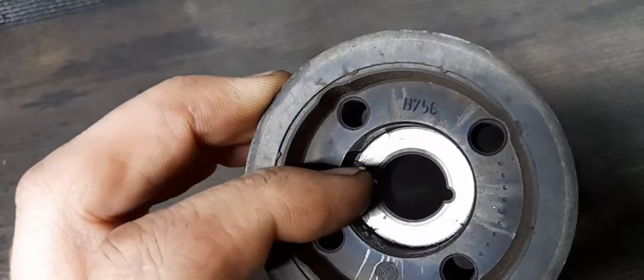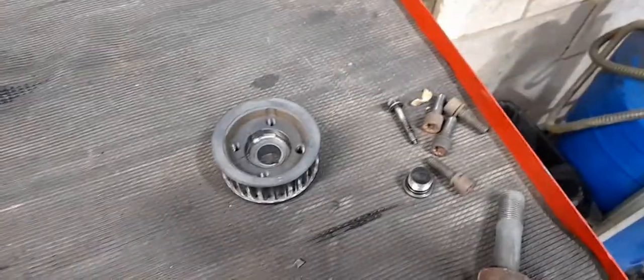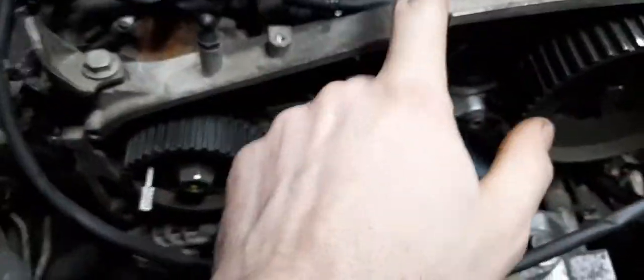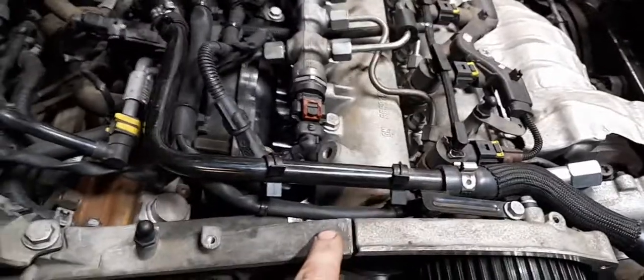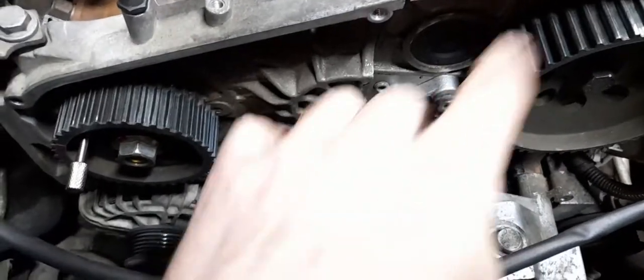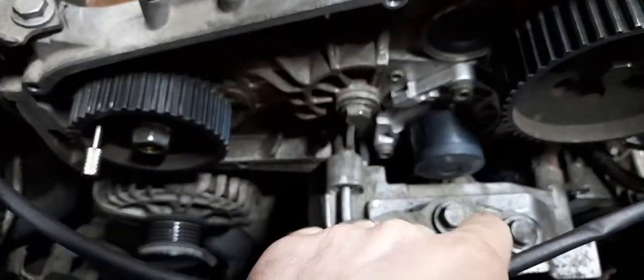It's actually sheared the key. I've called Vauxhall and ordered a new bottom pulley — they don't list the key separately so I'm hoping it comes as part of that. I'm hoping the bottom end hasn't spun too far and damaged the valves. We'll either strip it down or spin the engine back, pin everything up, fit the timing belt, and try to start it.